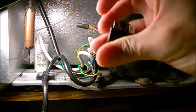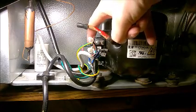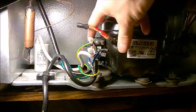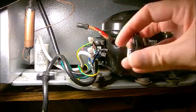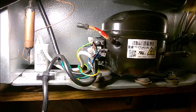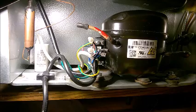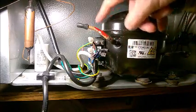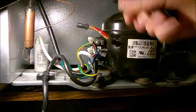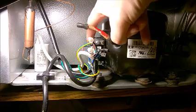That's the scenario when the piece fails while the compressor is running. The other scenario: the overheating relay may also fail. If the compressor gets too hot, this part fails and the compressor stops. If that happens you need to replace both parts. The overheat relay looks like this — usually you can buy them together on AliExpress for about five dollars; on Amazon you'll pay five times more. If you capture the compressor while still running very hot, the start relay should still be good and you may only need to replace that one.